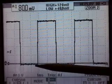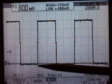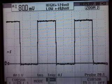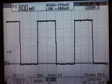We can see that we have an 80 millivolt switch — that's our difference between ground and where it switched. Anything underneath 100 millivolts is really good. The computer will see a switch at around 250 millivolts or less.